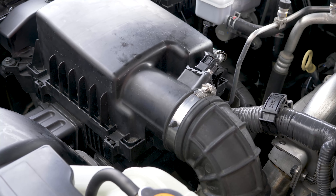Now it comes time to reinstalling. Make sure you just give the airbox a nice wipe over, get any of the moisture, dew and dust back out of the bottom there. When you go to put the filter back in, make sure you put it in into the bottom first, push it in and make sure it's evenly pushed down — it's not going to stop the airbox from popping back up.